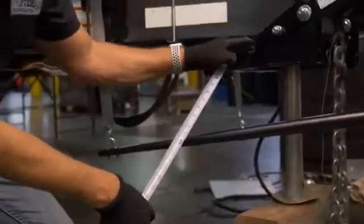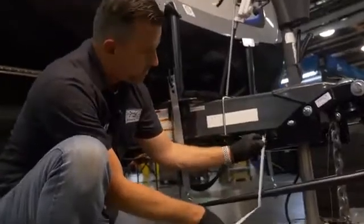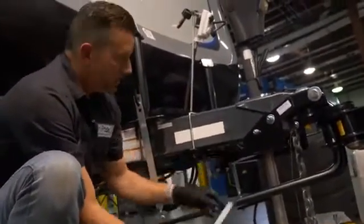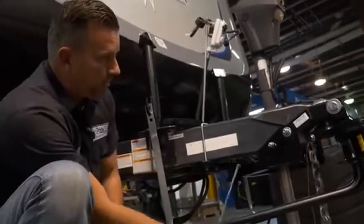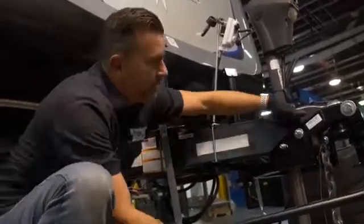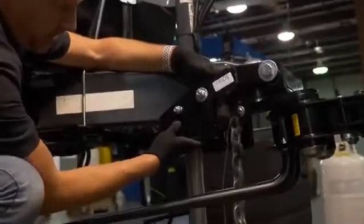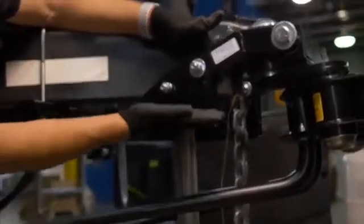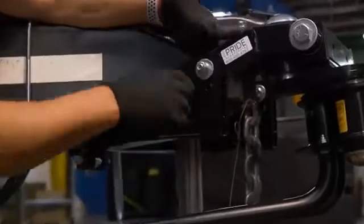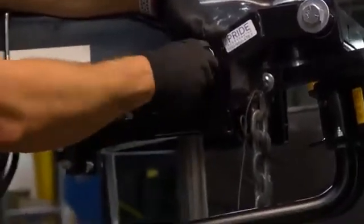If it's way less than that — most six inch frames, which this is — it's going to sit about one and a quarter inches right there, but it's parallel to this and that's what we're going for. Ultimately, if that's not the case and it's not sitting parallel to the frame, that's when you would adjust these guys accordingly so that it is parallel. But in our case it actually is sitting nice and parallel to the frame, so we don't necessarily need to snug these up.